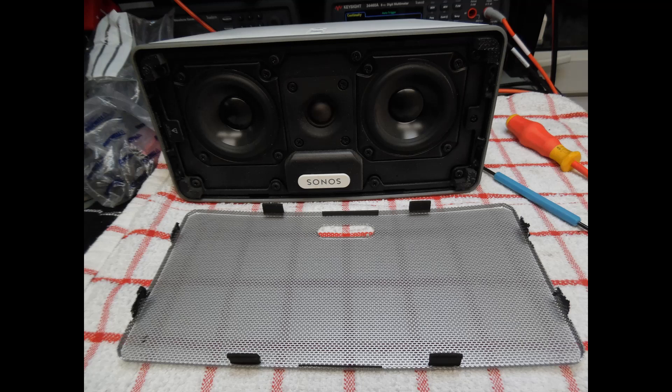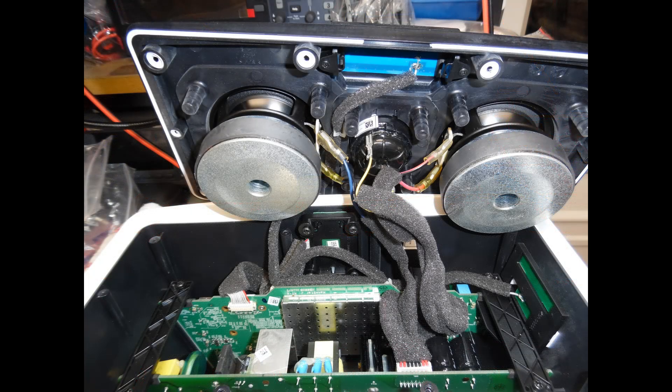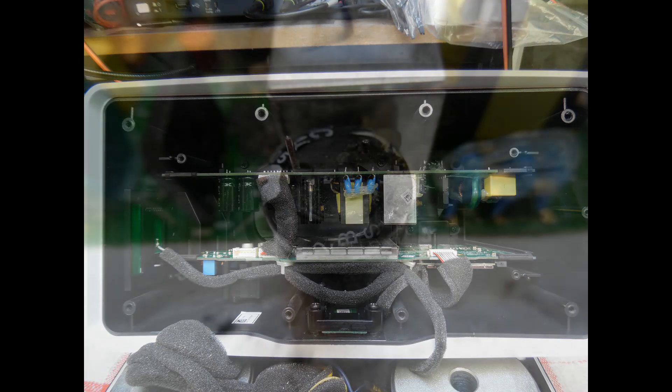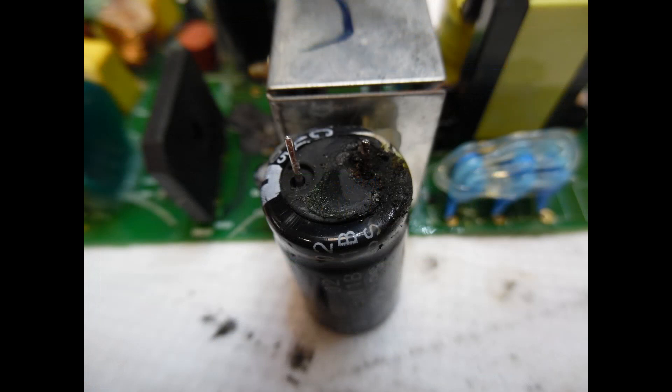Once the grill is off, you'll find a series of screws. Remove those, disconnect the speakers from the main board, and lift them out of the way. Then on the power supply board, disconnect the multi-pin connector that connects it to the amplification board and smart electronics. The power supply has two fixing screws right on top of the power input socket. Remove those, then remove the two plastic plates with grooved edges that cover both the amplifier board and power supply port - six screws in total. You can then slide out the power supply.